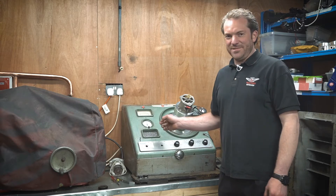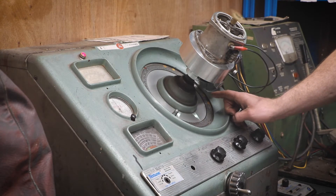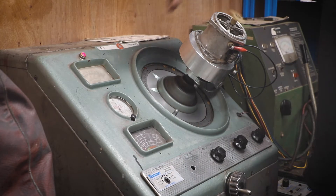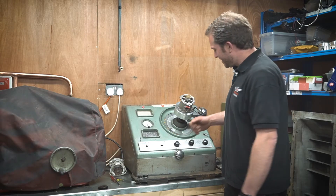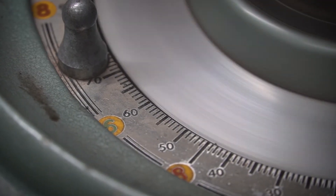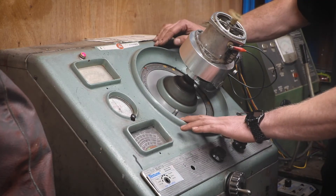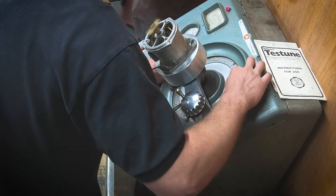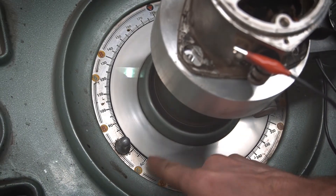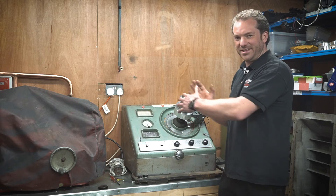I set the cursor up so you should have equally spaced ignition events. But as you can see here the gap's very tight, and here the gap's quite large — they should all be completely equidistant. This cursor that I rotate has marked on it for six cylinders, eight cylinders, and four cylinders, so the ignition events should line up with the sixes. This one lines up, that one lines up, and that one — but these three don't. That's most likely because the points are out. So we'll turn it off, adjust it, and try and get those ignition events at the same time.